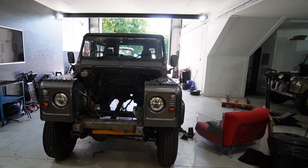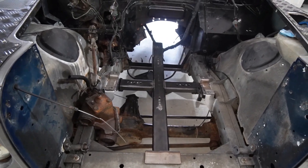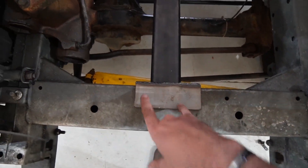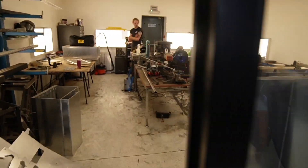We've obviously got the box that needs to sit in there, and this is what Toby and Ryan and the fabrication team have been making - this big 5mm steel crossmember that it sits on top of, onto the original TD5 engine mounts. We're not allowed to drill or cut anything, so the front is literally just sitting there, not bolted on, and on the back it's bolted to the original crossmember points - secured in four places. When we've got it in we rock the car and the whole car moves instead of the battery box. That's all done using our CNC plasma cutter table, so we know the design - we've built Defenders before with this battery box - and we literally press print and it all gets welded together by Ryan.